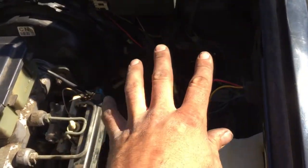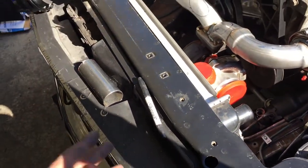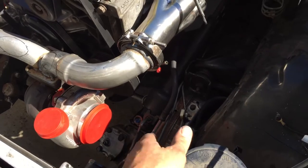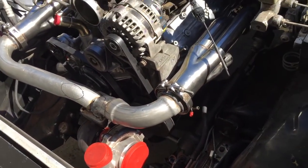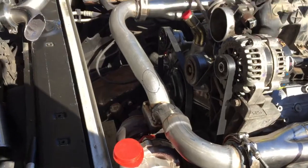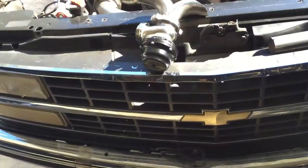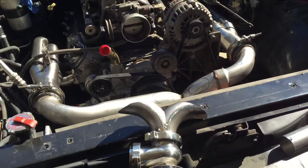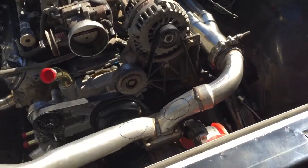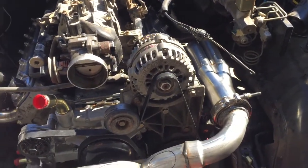And then we'll have a small storage tank up here, and then a small radiator or heat exchanger, if you want to call it that. They look more like a transmission cooler than anything, but up in front. And then a water pump assembly down here. I've mocked one of these up before, so that'll circulate the water to the water-to-air box. There's not a lot of room for a typical big plate air-to-air intercooler that you run on these or on other stuff. So I've decided that you can get them for $150 for the water-to-air. Now, I have to get a few other components to make it work, but we'll do that. And once this is all piped in, then it's just tying this into this truck. But this truck should be a monster.